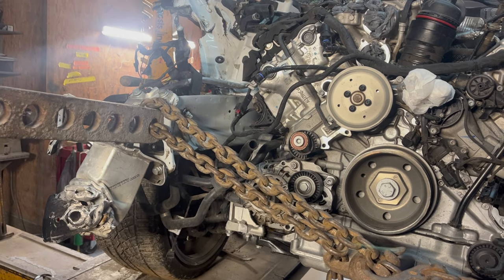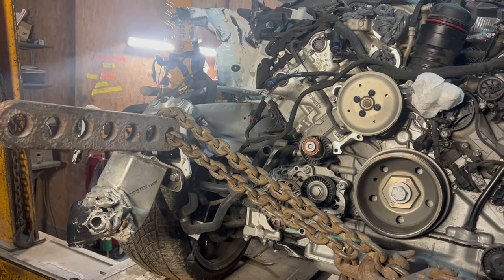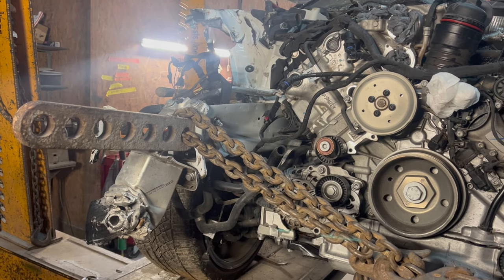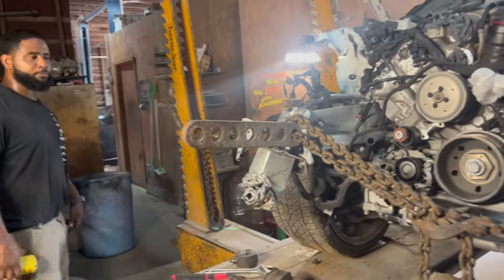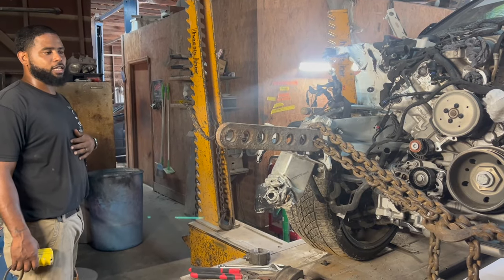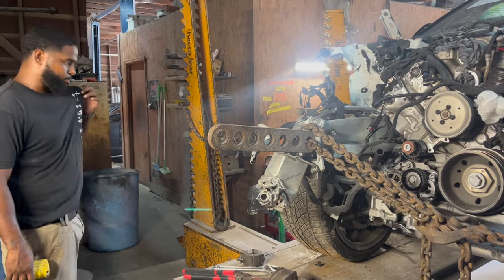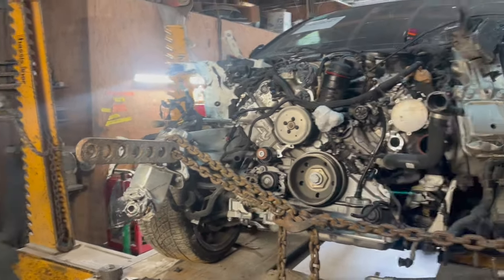Still got to probably pull it with another 25 to 50,000 pounds of pressure. But one more, maybe two pulls, and this whole upper frame rail will actually be back to almost its original position. Original shape? No, because we're going to cut it in and redo it. But it'll be back to its original spot. You heard the man. Let's keep working.